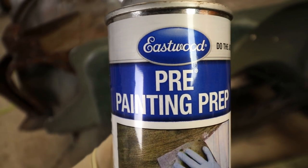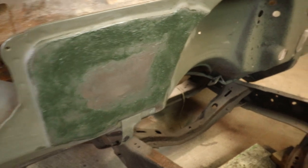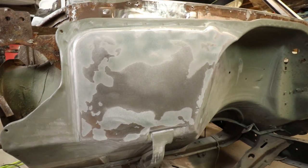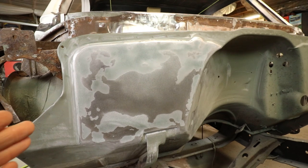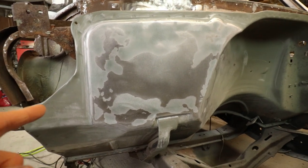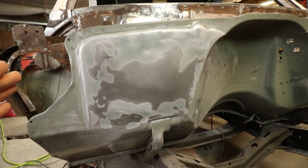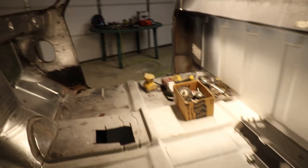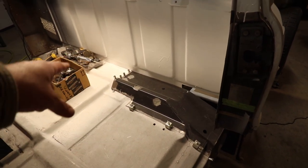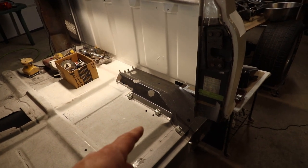Make sure you clean the metal before any type of filler work or paint. Here's how we're looking with the firewall — I got the fiberglass filler on the spots I needed to, on the inside and outside, and it's sanded. It took way too long — next time I'm using 36 grit. In a normal world I would take out my polyester filler at this point, put a skim coat on here, block it out and make it nice and smooth — which I will do, but not now. For now I'm just going to prime it and move on to the next project. The next morning the paint has dried and I'm pretty happy with it. I'll throw some self-etch on here before I wrap up in the garage tonight. But for now I'm gonna finally get going on that cab corner — my goal is to have this piece welded in by the end of the day. See you in the next video.